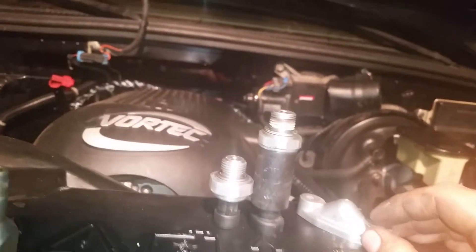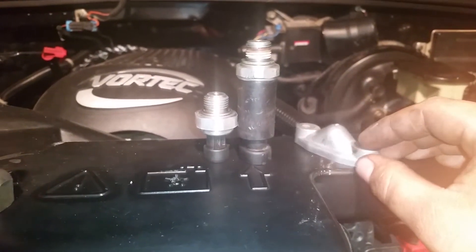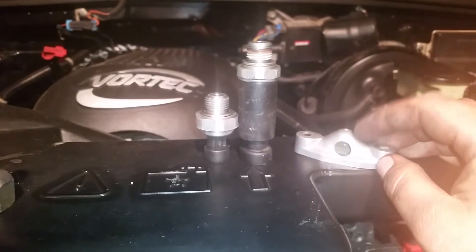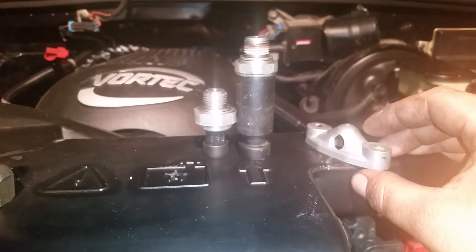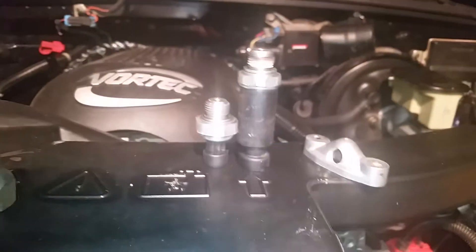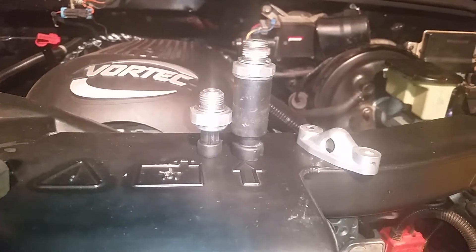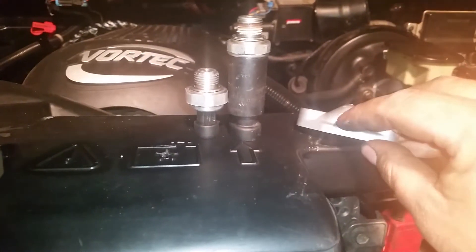I put these three here because you might have one of these three going on. Above your oil filter there's a plate — it's a block-off plate for the oil cooler lines — and they're not used on pickup trucks. So what I did was drill a hole out: it's a 7/16 drill, and then you follow that with a 1/4-18 tap. Just tap a hole out there, drill 7/16 and then chase it with the tap.